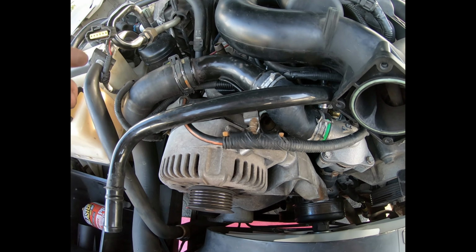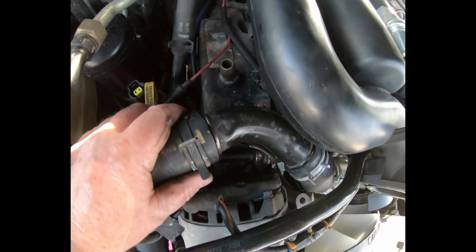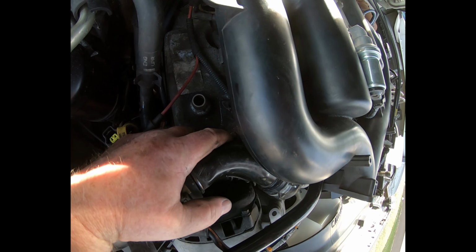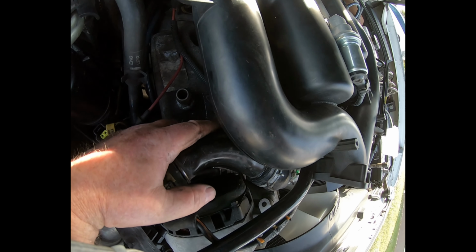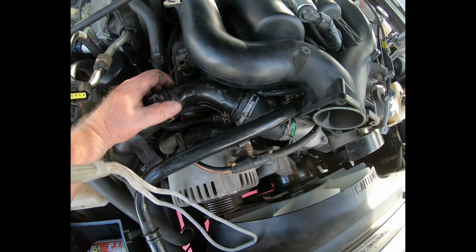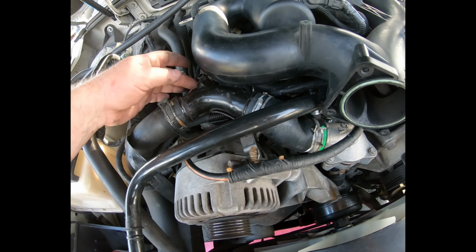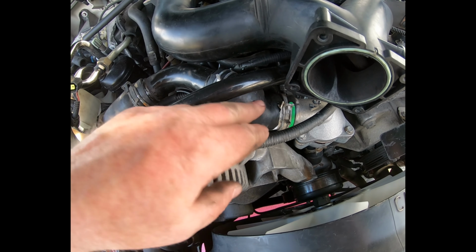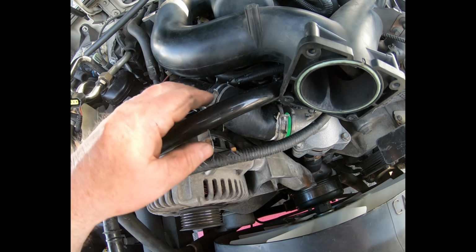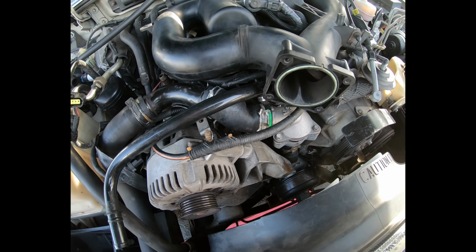This is the section that we had welded. It went on normal, but getting it bolted down, which is back here, right here, that was a bit of a chore. Bolt goes through here, but there's a little nub off the intake housing that fits through a slot on the hanger, and that's got to be in place before the bolt can line up properly. Now, as you're doing that, you're pressing against the force of the rubber hose, trying to compress it to get that in line. So I had to use a pry bar to raise up on the hose to get this in line, and in doing so I then had to keep loosening these up and try to move the hose back and forth to get the twist out of it. And I think that should work, actually, the way I have it now.